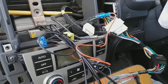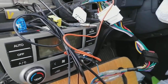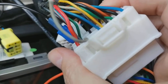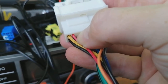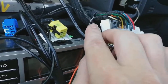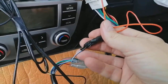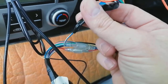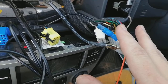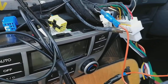Quick tip: if you get no sound from your aftermarket radio when it's in — it powers up but no sound — it's the amp cable. On this wiring block there's a gray wire, third from the end on the top row, and you'll notice it doesn't have a wire coming out the corresponding side — it's just an empty bay. This wire turns the amplifier underneath your seat on. What you need to do is connect that gray wire to the blue wire that comes out the back of your radio. The blue wire normally runs electric aerials, amplifiers, and similar. This is a UK model, so do check, but this is the power feed that tells the amplifier to switch on — without doing this, on some of these it won't work.